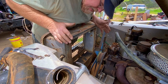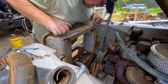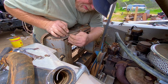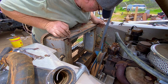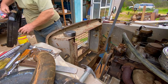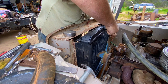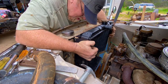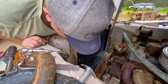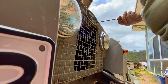We've had a look at the radiator and to get the 2A radiator in here, this piece of metal is in the way. These holes actually align, but this might also be in the way — I'm going to bend that so it becomes a side mount and we'll see how that sits. First thing is to get this out and take this off to get inside with the bolts for the radiator.